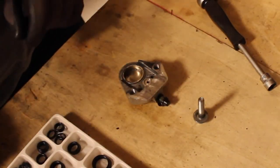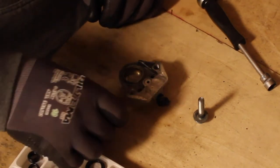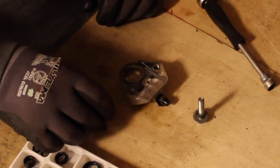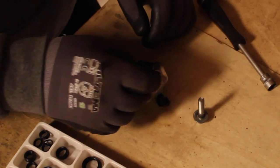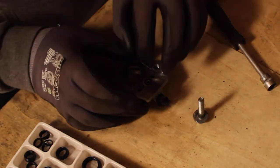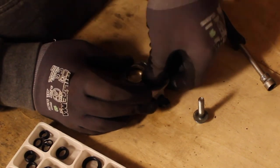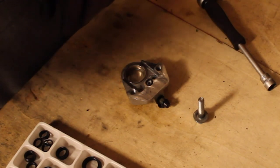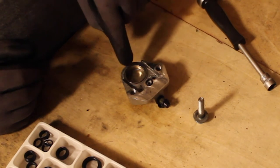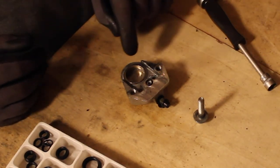So now, if I take — I think this O-ring, I think it's 10 millimeters in diameter — and I put it right in here, because I think it fits perfectly, then you just gently give it a bit of a shove in there so it sits there nicely. Also, let's hope that these O-rings can survive the brake oil, because a lot of rubber stuff gets dissolved with brake oil.